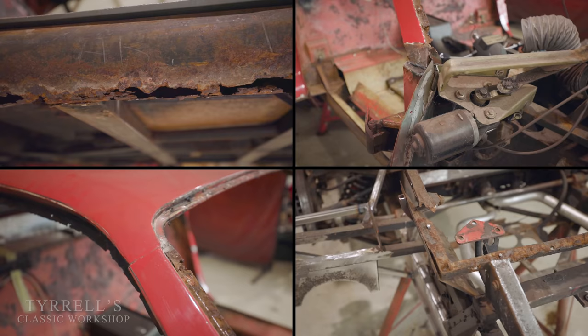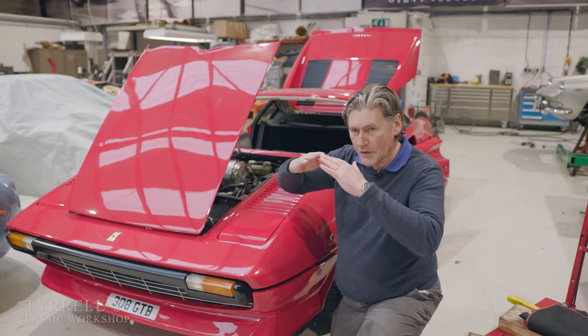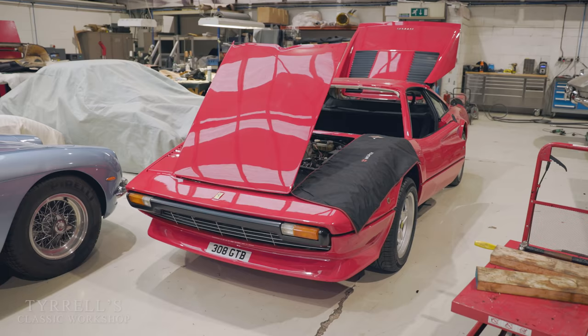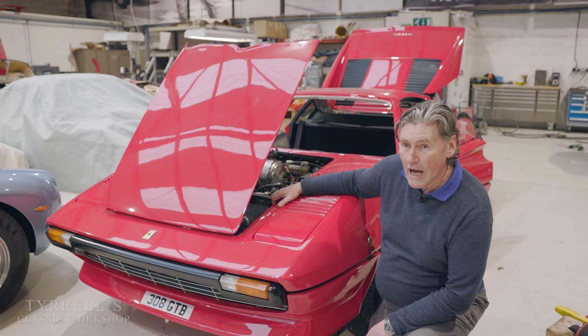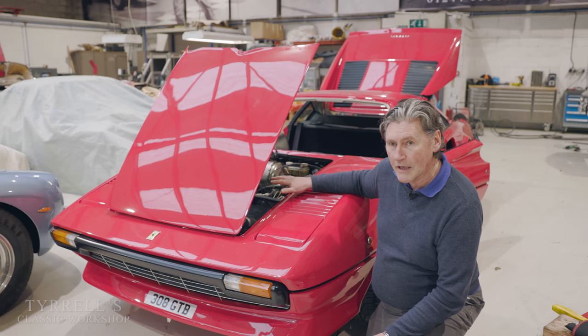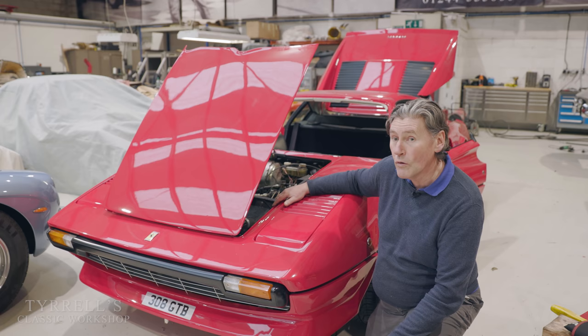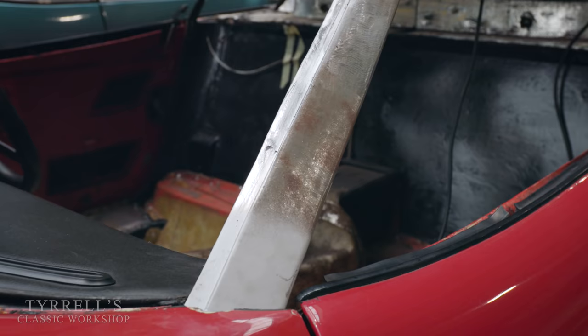This is the fibreglass 308 that was just about to break its back - the chassis was almost rusted through, you could put your hand inside the hole, and the A-pillars were also virtually rusted through, so the whole car was just about to give way - very dangerous. People think that because it's a fibreglass 308 it doesn't rust under the skin - how wrong can somebody be. I suspect there are a lot of fibreglass Ferrari 308s out there in the same predicament. Any owner of a Dino 246, 308, 328, or even an F40 - all basically the same frame within reason - I would strongly advise they take the aluminium under-sheet off and have a look at the chassis. If there's one thing I can say in this video that might save somebody's life, it's that.